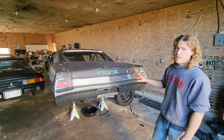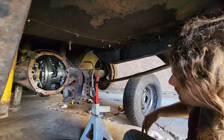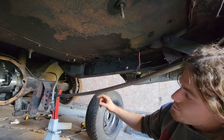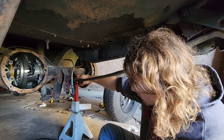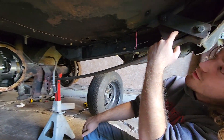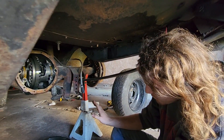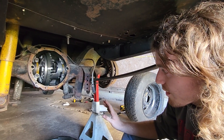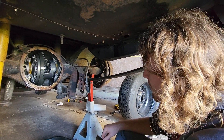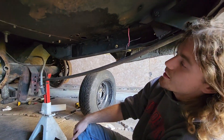What me and Peter did just now is we tore apart the diff. This is probably the best part of this car — the whole rear axle setup. It's really pretty good and I think we're going to be able to leave most of it the way it is. The suspension in the rear has these nice mono-leaf springs, which are what you want for drag racing. There's just one leaf on each side with these floaters — the leaf spring rides in the groove and that allows the rear end to float on the leaf springs, along with the shackle sliders, so you can run a more aggressive suspension like the ladder bars on here. The ladder bars look a little sketchy but we're going to try them out. It's a shortened 12-bolt with Strange Engineering axles and C-clip eliminators, so we're good there rules-wise.